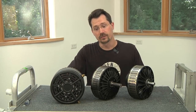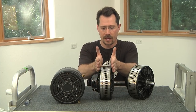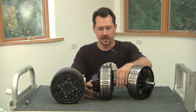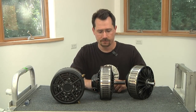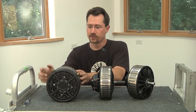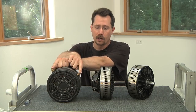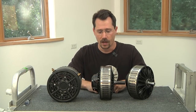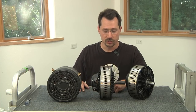These are all permanent magnet motors. Each one of these has permanent magnets on the outside, sort of the frame of the motor, and then the rotor itself — the armature that has the electromagnet in it. All three are like that. You'll also notice that all three of these have two power connections on them. They're all reversible — if you swap the polarity of your power cables to the terminals, the motor will spin the other direction. Pretty much all of these are designed for either clockwise or counter-clockwise power configuration.